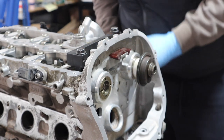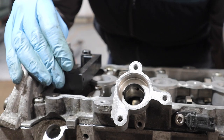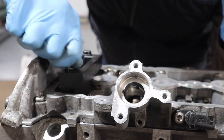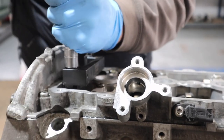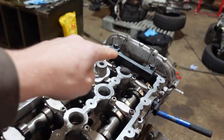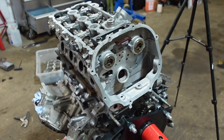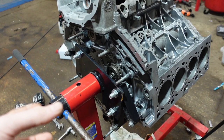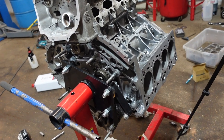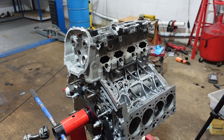I think I can now get a spanner to bring it back a little bit. The tipping point is a very small window. The right-hand side is now all fully built up apart from the rocker cover, which can't go on until we've timed the engine because none of the chains are on. I've taken the engine slightly off TDC at the bottom so the pistons aren't at the top and we can rotate the camshafts; I just need to remember to turn it back about 20 degrees. I'll do a time-lapse now to build up the other bank.